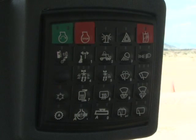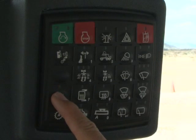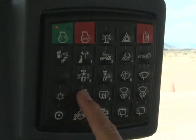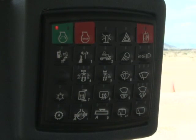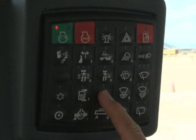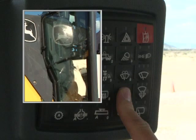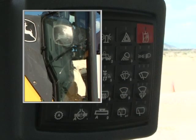The left button in the fourth row turns the air conditioning compressor on and off. The next button turns on and off the outside heated mirrors if equipped — if turned on, the heaters will automatically shut off after 15 minutes. The next switch is the rear window defog; note that the defogger will automatically turn off after 5 minutes of operation. The next button is the lower windshield washer — push and hold it to operate, and the wiper will automatically swipe several cycles.